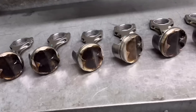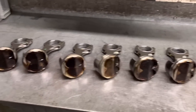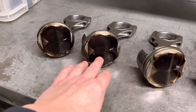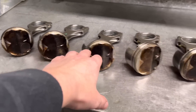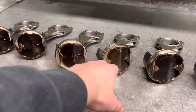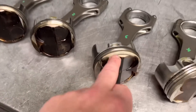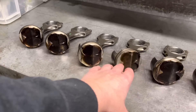So the BMW engine - we've got the pistons down here, 1, 2, 3, 4, 5, 6 in order, front of the engine over here. You can see the crown of piston one is a bit black, looks a little bit over-fuely. As you run into the middle, the two centre ones look a little bit lighter brown, so I suspect they've been running a bit weak. You can obviously see blatant detonation - on the side of the piston there you can see it has been burning away and getting quite warm on the top.